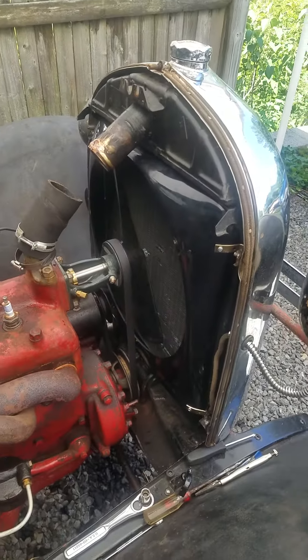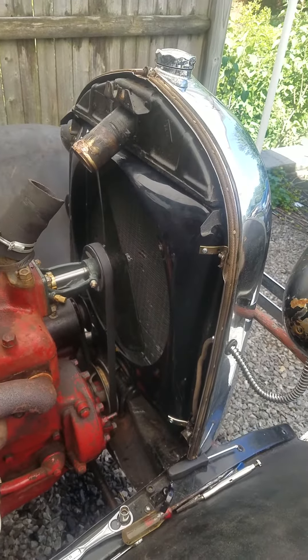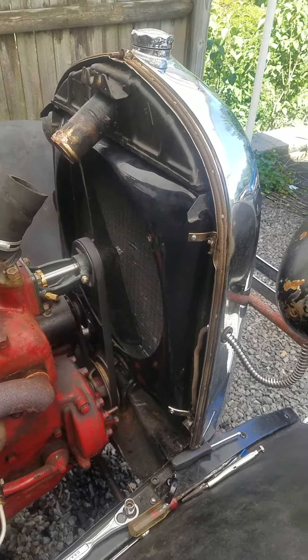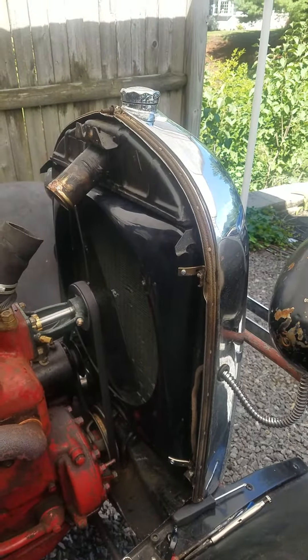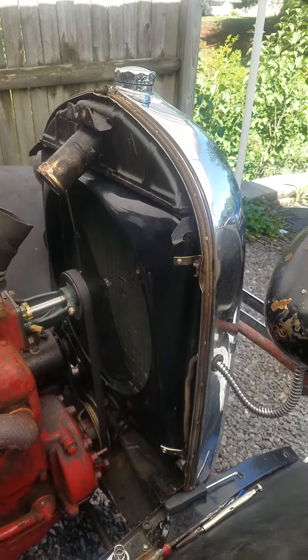I got this plastic shroud in here, it actually fits really rather well, better than I expected. I made a mistake first go around — I put the brackets on the inside of the shroud. Looking at the pictures, you have to put them on the outside; it actually pulls it in and tucks it in tighter to the radiator that way. Seems like a decent kit, I think it's gonna do what it's supposed to do.